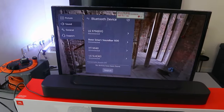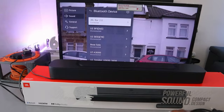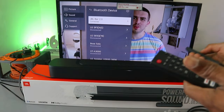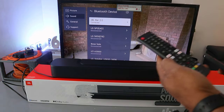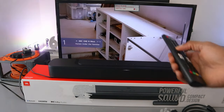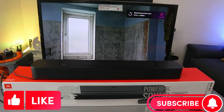You can see it picked up the soundbar — it picked up JBL Bar 2.0 from the list. Select the center button on the TV remote control to connect, and it's connecting. Now you can see JBL Bar 2.0 is connected. Use the remote control for the soundbar and the TV to increase the volume. When it's in Bluetooth you can also control the audio using the soundbar remote or the TV remote control. Thank you very much guys — if you're happy with this please like, share, and subscribe, it helps the channel.